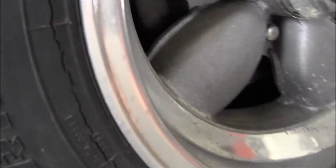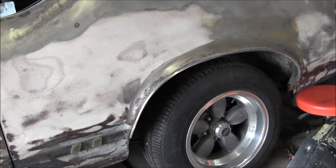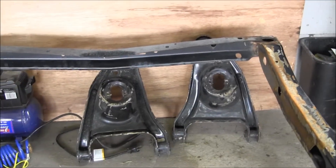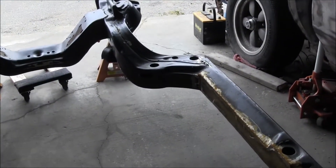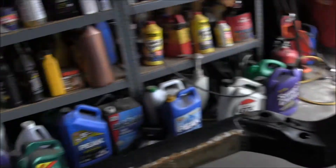It's a shame these tires are all dry rotted on the sidewall — there's lots of good tread left. They may just be burnout candidates once this thing's roadworthy. Paints never showed up so not really going to do a whole lot to this thing this weekend. Gotta clean up those lower control arms, get them refinished, swap out the fittings, and do the ball joints. All the parts are laying in here. At least this thing's been cleaned and degreased — blow-dried — pretty much. Got some moisture in here still so I'll just let her sit.